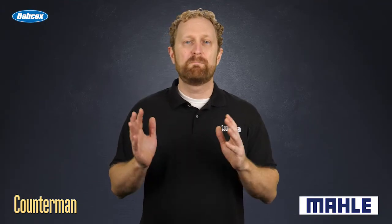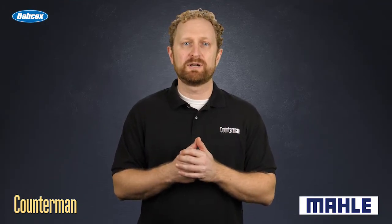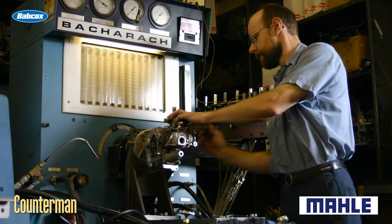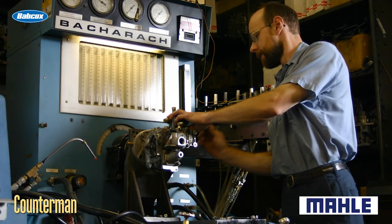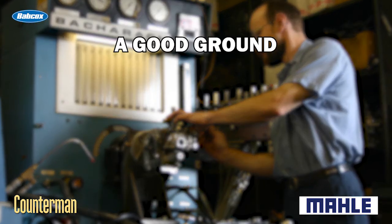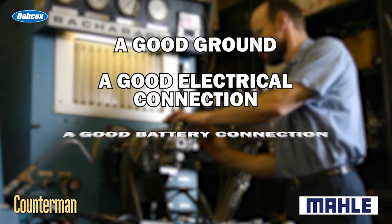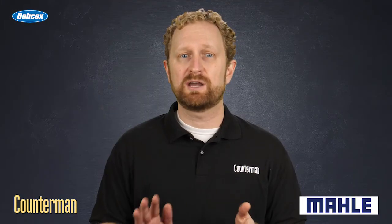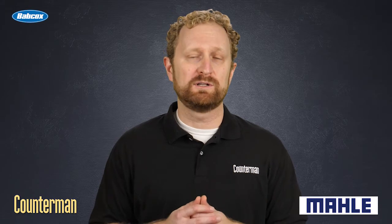For parts specialists, a bench tester can verify that starters and alternators are functioning properly when they go on the shelf and off the shelf. Something to keep in mind is that verifying whether a starter or alternator is good requires 4 conditions: a good ground, a good electrical connection, a good battery connection, and a tight belt. Some bench testers can help counterpros diagnose which of those 4 conditions weren't met.